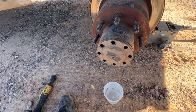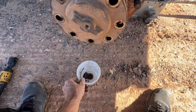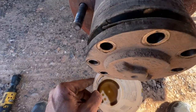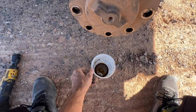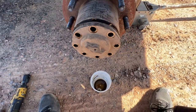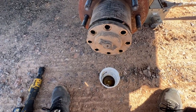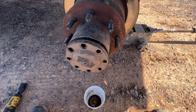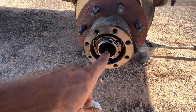Yours may be like mine and not even need the hammer. There's that oil I was talking about. I dropped a bit of dirt down in there from the dirty hub, so it's not stopping the oil. It looks to be slowing down and I've got a rag to catch a little bit of it. As you pull the axle shaft out, you're going to want a rag to clean the shaft as you pull it, because you don't want all that dust on the shaft going back to your differential.